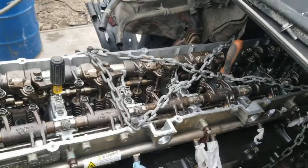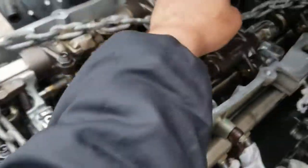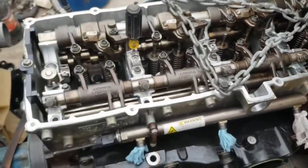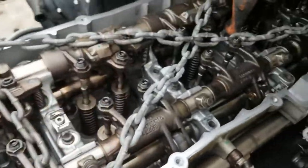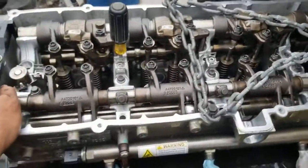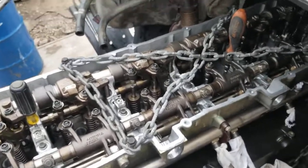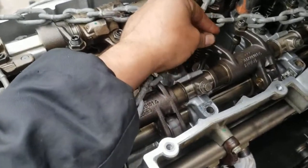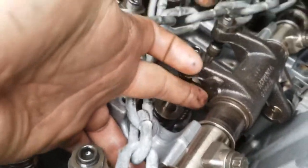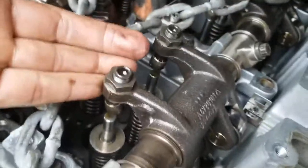What I've done is very slowly lowered it, using two fairly long Phillips screwdrivers as guides. You have to make sure you lift on the rockers when you're lowering this piece, otherwise you can bend a valve or break something. This cam housing definitely requires two people to lift unless you're Superman. Make sure the rockers are up because they have a tendency to come down and the rocker will get stuck on the side of the valve — so make sure they're lifted before you drop it.